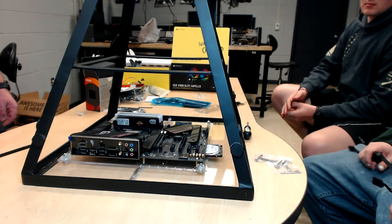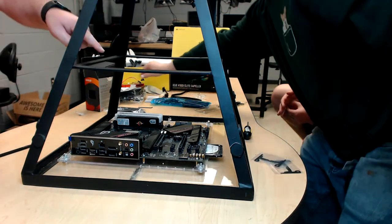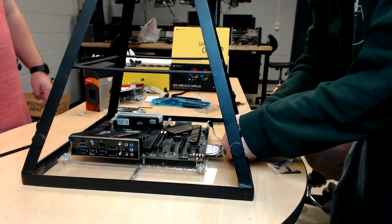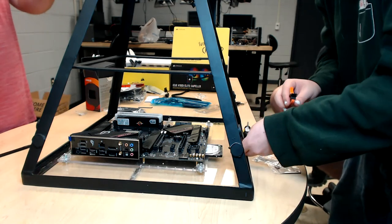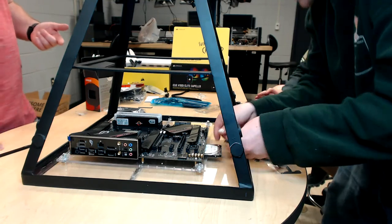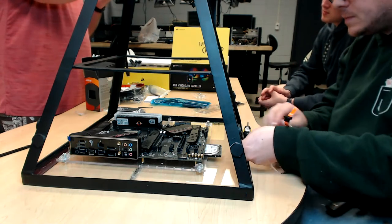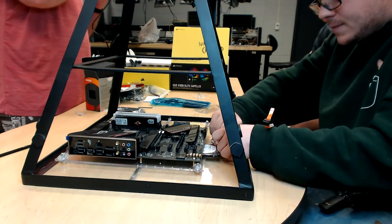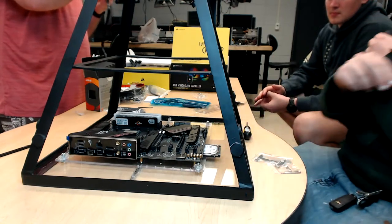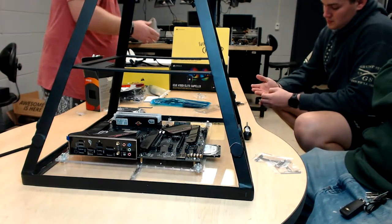So let's assume we leave it mounted like that and we just solve this problem by getting a straight-on clip. Yeah, because SATA is going to be... Well, not all SATAs are 90 to straight. Yeah, so there are plenty of SATAs that are just straight to straight. So that's all we need. Yeah. So we need a straight power supply. Unless there's a way to redo this clip that I'm not aware of. Yeah, so that's fine. You know what I'm saying? I don't think there is. No, probably not. Okay, but I know I've got one.